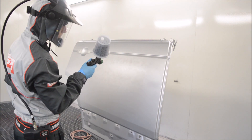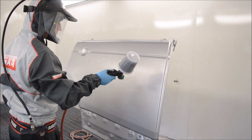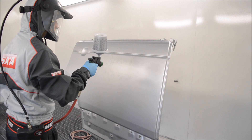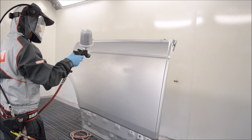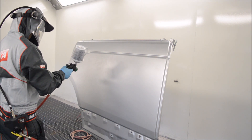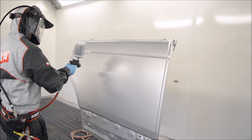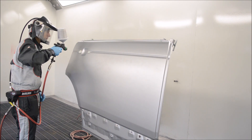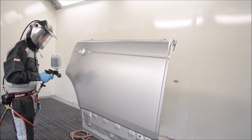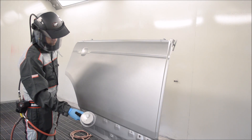Some colours may vary and you may need one, two, or three drop coats depending on the colour and how badly the metallics have laid down in the first place. When applying the drop coat, make sure you apply it as a light, even mist coat, waving the gun over the panel rather than going edge to edge and triggering off. This is just what I recommend — different manufacturers and tech guys will tell you different methods, and they will all work. It just depends on the painter and how you feel comfortable applying the paint.